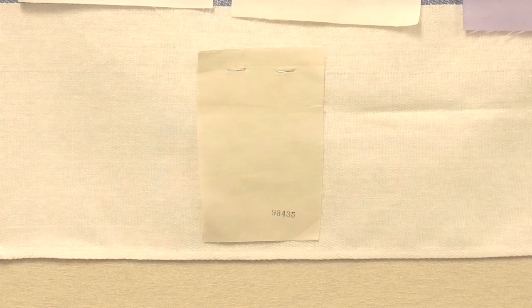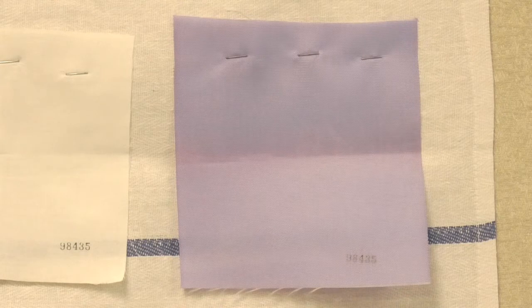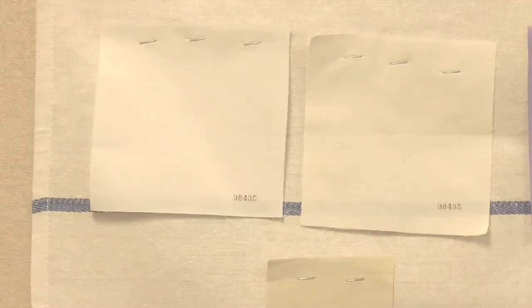The Rug Soil Swatch evaluates whether your detergent, concentration, or wash cycle length is adequate. The Purple Swatches indicate how effective your cleaning system is at removing water-soluble soils and stains such as food and beverage spills. The two other swatches do an excellent job of catching the graying and yellowing caused by soils and dye bleeding.